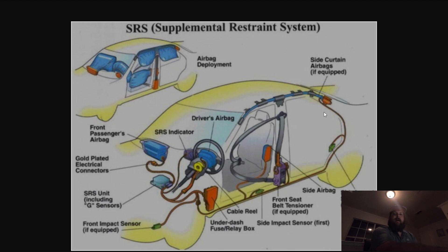So let's get into this. This is my first time ever doing this, so if this screen capture doesn't look good, I'm sorry. Essentially, in order to even start on airbags, you kind of got to understand the airbag system. So if you look here, we got a diagram of a basic system. There are basically four main components: your airbags obviously, your seat belts and retractors, your impact sensors, and then the module itself.